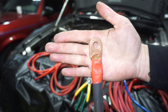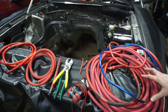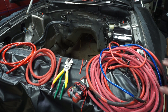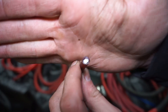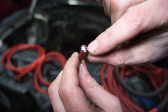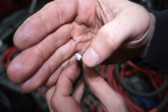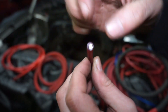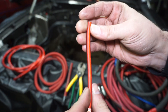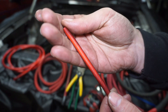Plus when you get to the point of crimping on these big lugs, these lugs are going to cost you a lot more. So if you're doing bigger physical size wire, you're going to need bigger heat shrink, bigger lugs — there's extra cost that goes into that too. Another consideration with cheap cable is the casing is actually pretty inconsistent. You can see one side of the casing where my thumb is doesn't have very much material, while this side is actually really thick. The wire is almost rubbing through right there. A lot of cheap CCA cable has pretty inconsistent casing and you can rub through it a lot easier.